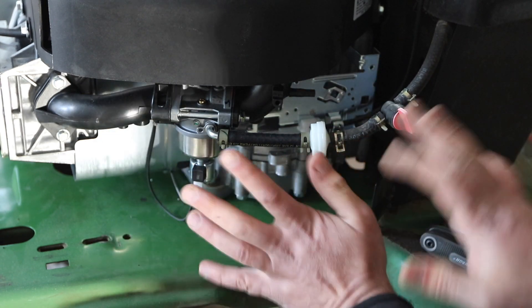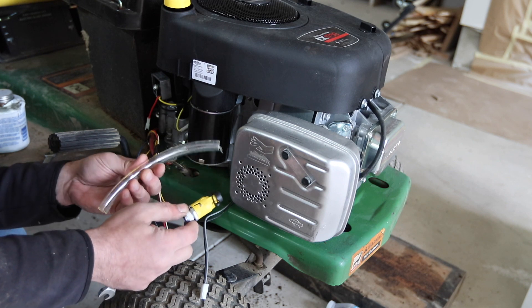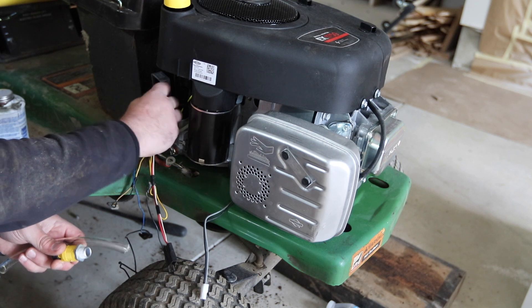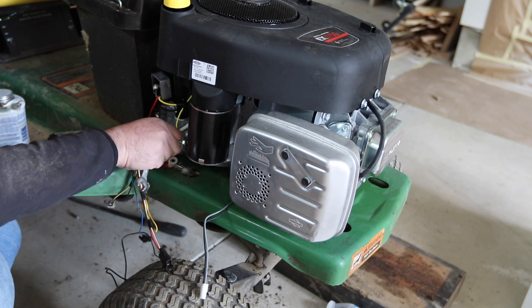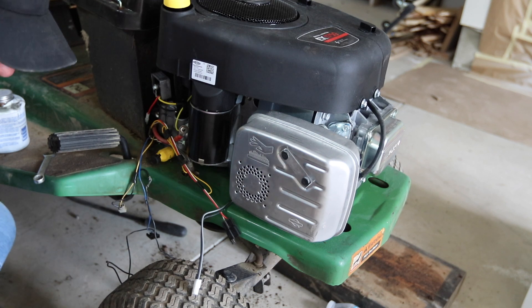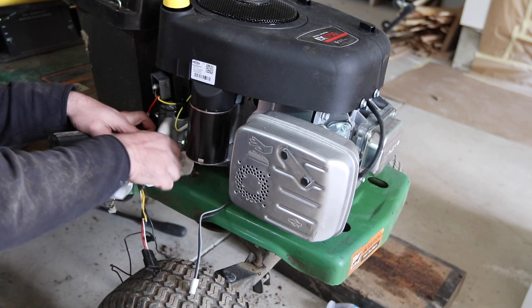This side of the swap is done. The common upgrade is to buy this oil drain kit — it comes with a quick-release oil plug and a cheapo plastic tube. It's a lot better than these things just draining right onto the deck, which is worthless. I'm using a 7/16 to take the drain plug out. The other weird thing about these motors is there's no oil filter. Installing the drain fitting — it's hitting the deck, which is kind of annoying, but once it's on, it's on. We'll see if she leaks.